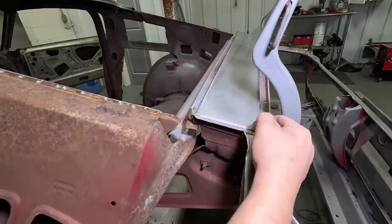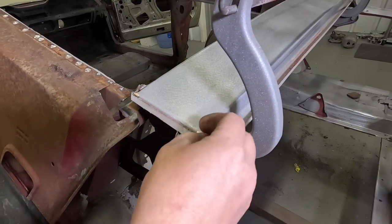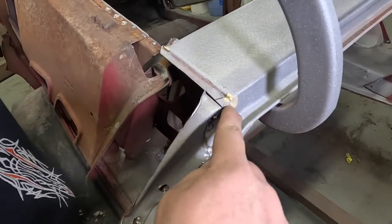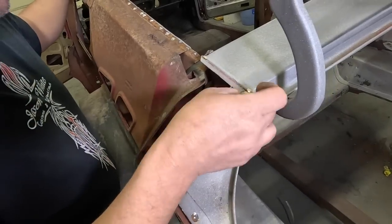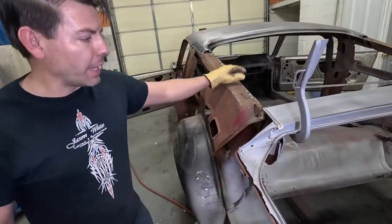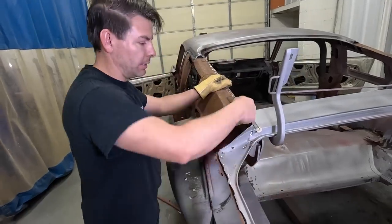Now the brass can sometimes be a pain because that stuff actually is like liquid and it'll flow in the nooks and crannies. So you have to be delicate and hand chisel where the brass is, especially in here. You can't really melt it out, you'll warp it. So you just gotta cut it, or take pliers and work it back and forth until it breaks out. But we can get access to drills, because otherwise there's no way you could have crawled up in there and drilled that without slicing it that way.